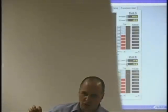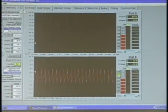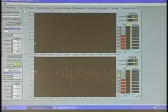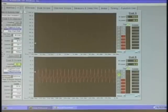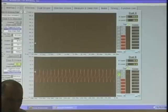Big difference. Now, the other thing with this: let's say this is the only tool you had, and we're looking at wheel speed signals. What you want to do is AC volts, the little wave, and go here and find frequency, Hz. You would check the frequency of the signal from wheel to wheel on a level surface. Of course, driving, but on a level road. Not a bumpy road, not a turny road. Why? The wheel may spin at a different frequency. Frequency is the number of times something happens in a second. So I want to come around and look at your meter and see the frequency and tell me what you have on it.